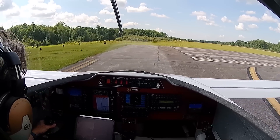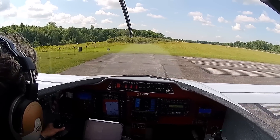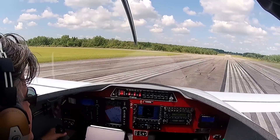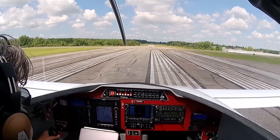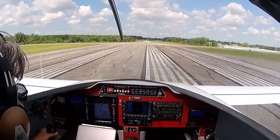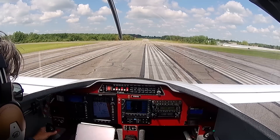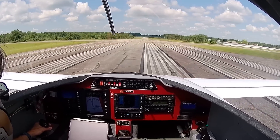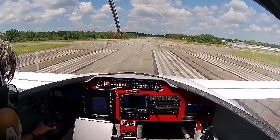I did a test flight and I was blown away with what I saw. At idle, 45 degrees before top dead center. Then static full power run-up — RPM is 2190. With manifold off, timing goes to 35 and RPM goes up to 2220–2230. Manifold back on, timing goes to 51 and RPM drops to 2170–2180. So I think the EIS does need to be adjusted.